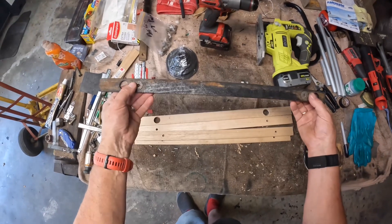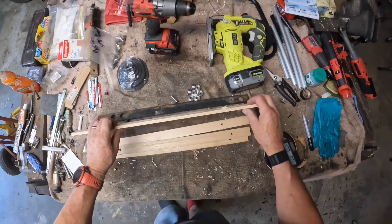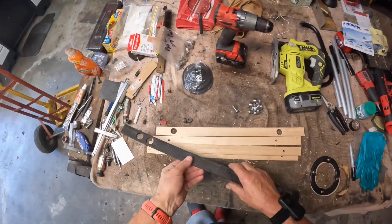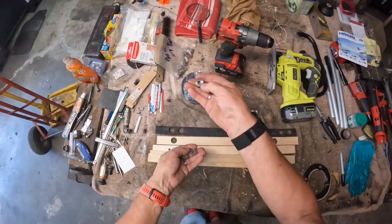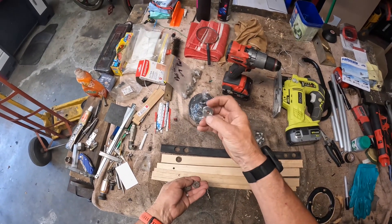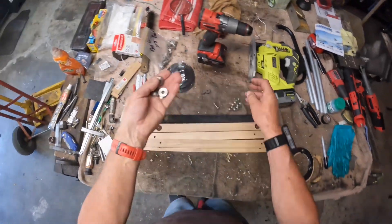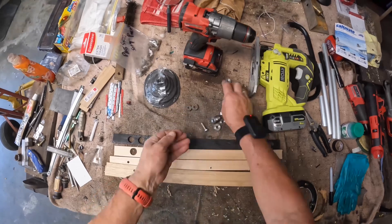These proved very handy right now. I've got some wood which is 8mm by 30, which is not exactly what came out - I think the original looks like it's about 6mm. I was also short of these spacers, so I've machined up eight new ones out of stainless steel. No doubt I'll get some galvanic corrosion at some point in its life, but I'm not particularly phased about that. So yeah, I've made eight of these up and they're all ready to go in.